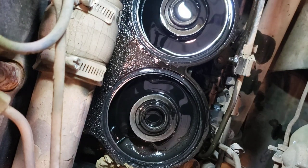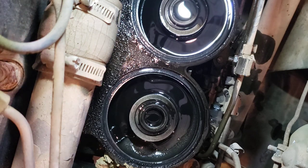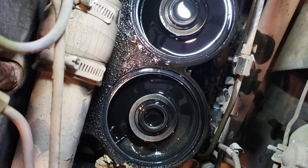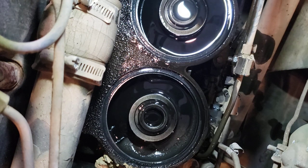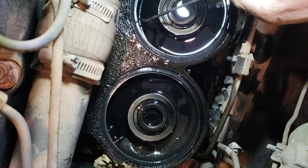Here's another one for you. I've seen a lot of people, just like with the fuel filter gaskets, say that they put everything together and just cannot seem to get the oil filters to seal with the gaskets. There are multiple gaskets that come with these filters depending on where you get them, but the flat gasket is what you want. People say they're too big or too small, but I think it's really just people not understanding how the gaskets are supposed to go in, because I've never had that issue. Let's start with picking the gaskets out — you'll need a pick for that.